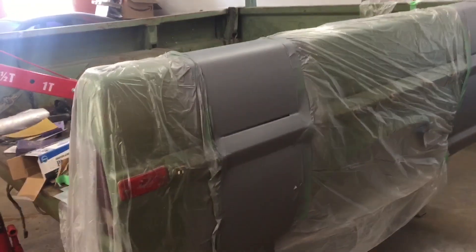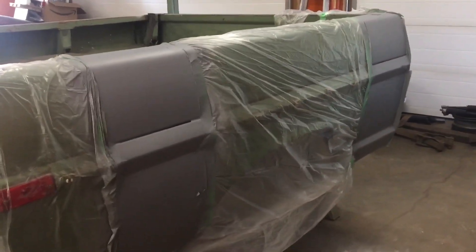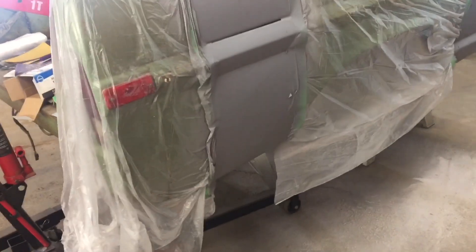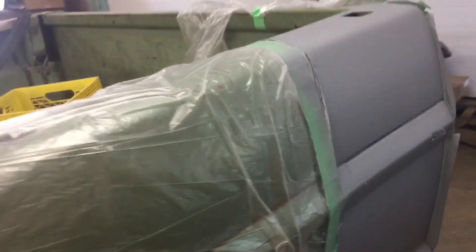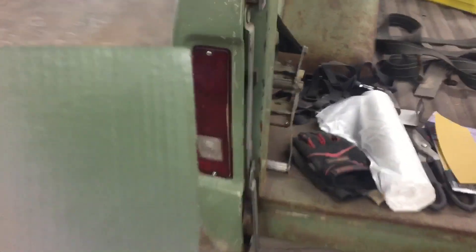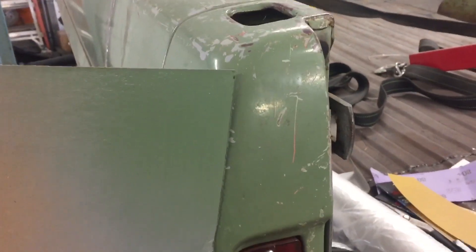Here's where we are now. I've shot two coats of primer on this - the first one I sanded down and then I sprayed it again. I'm gonna let this set up nice, then come back, pull the plastic and tape off, and feather the edges in. Then I'm gonna try to tape it and blend it in with the paint. I did spray a little sample of the paint on a piece of cardboard - the paint looks like it's gonna be a pretty good match.